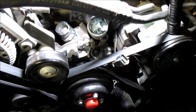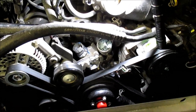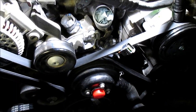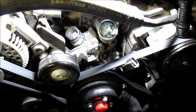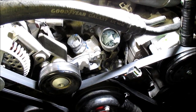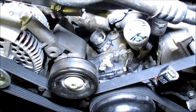I also sprayed down the gear itself with some WD-40 just so it had some initial lube on it as the engine is starting up. It doesn't seem like there's a whole lot of oil that gets splashed down where that gear is, even though there's a timing chain in there — and it must get oil somehow or the chain would fail. Anyway, let's get that hold-down bolt in, do a final check, and then start working on reassembling things.